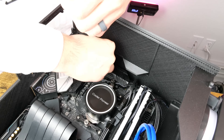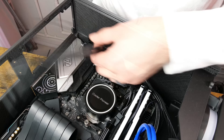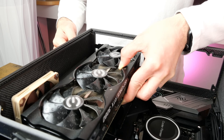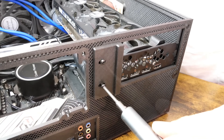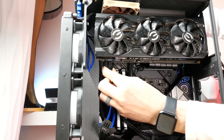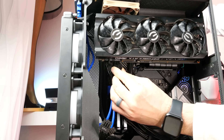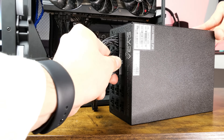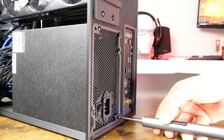With the proper length cables, installation becomes a breeze since there's little wire management needed. Connection locations might be different based on the motherboard and power supply you use, so double check the cable lengths on your own. Next, we'll install the front IO using some screws. I carefully installed the GPU into the riser — theoretically an RTX 4090 should fit if you're rich. Slide the GPU cap over the tab and use the two screws to secure it. My GPU requires two 8-pin connectors, but yours may need more, less, or none. It's a little easier to have the 24-pin cables attached to the PSU before shoving it in place. The PSU screwed into the back panel like with any other case.